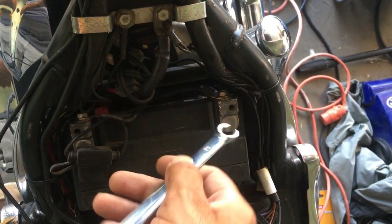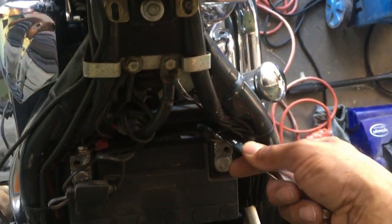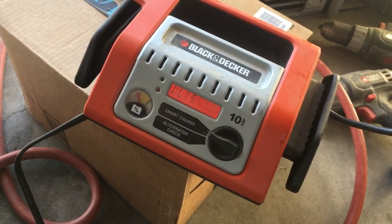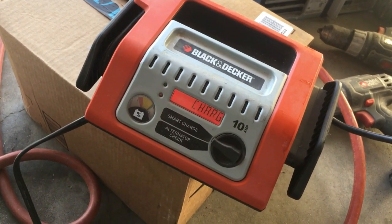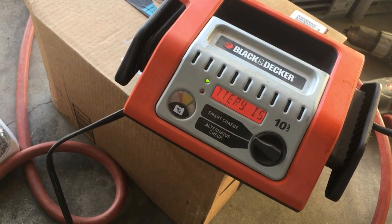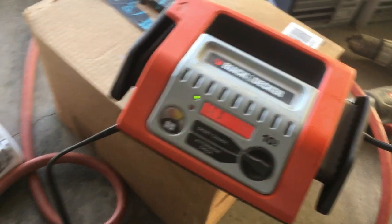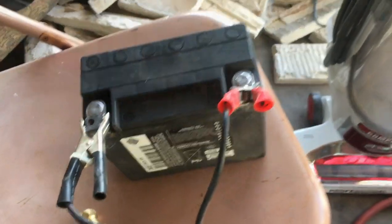It's a 10-millimeter. I hooked up my battery charger and it ran diagnostics — it says the battery is fully charged, so obviously it's not the battery itself. I think oxidation was the problem, because I cleaned up all the terminals, put the wires back together, and I haven't gotten the code anymore. I hope this video was helpful.